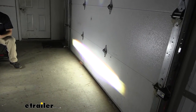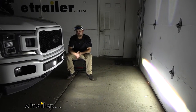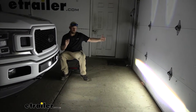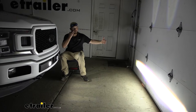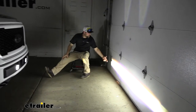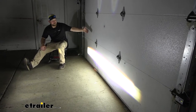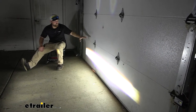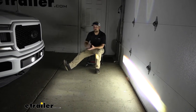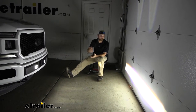They're going to be 20 watts and 3,000 lumens. So this is the fog light type, and in our dark room it's lighting it up pretty good. We're pretty close to the garage door here — if it was further away we could get a better idea. But there's almost a perfect rectangle beam of light. So I can imagine another 50 yards out in front of us on the road, this would probably cast pretty good light across the whole road, and stay low enough if you have them mounted up properly to stay out of other motorists' eyes.